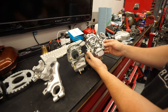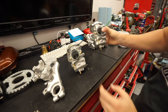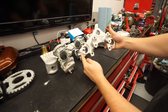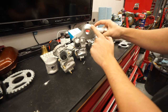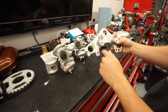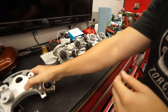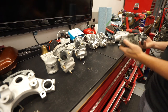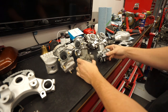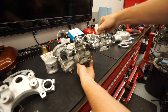You can see this is why you invest in a vapor blasting cabinet — you want the carbs to come back looking like new. Here's another side-by-side: the left side was done with the old media, the right with the new, and you can see that nice satin finish versus the rough, almost dusty matte finish. The old results would work if you were going to paint afterward, but if we want to keep raw aluminum, the new media is clearly what we're looking for. This last true side-by-side is the CB750 carb body in original condition versus vapor blasted — pretty insane.